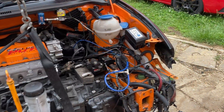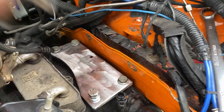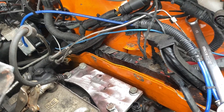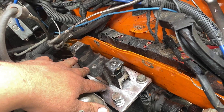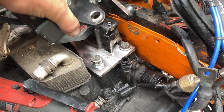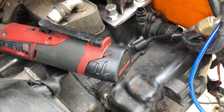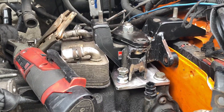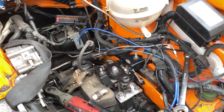I just made the mount mock-up. What I done was cut a plate about 10 millimeters thick with my grinder, tighten it into the gearbox, and cut the original engine mount of the gearbox. I'm going to make it sit like this — the plate goes like this, then I need to figure out what to do with that bolt, but that's minor. I'll take it to the garage to have it properly welded to be strong so it doesn't break.